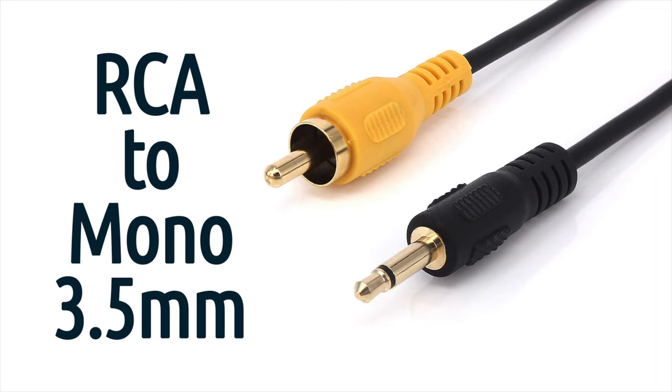If you want total control of what's coming out of the left speaker versus the right speaker, you'll need two separate cables. A cable with one black line is mono — it takes the sound from one channel of your equipment, for instance the white RCA, and feeds it to your left speaker. You then get another cable of the same design and feed it to your right speaker, giving you better sound separation.